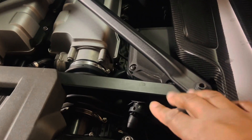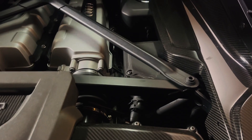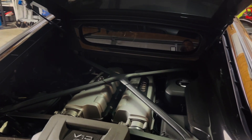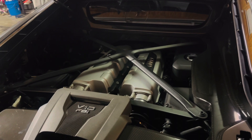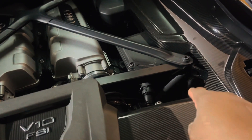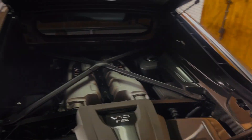Also on this side, as you can see right here, the fuse box. I had to remove this carbon fiber paneling piece, and that was a nightmare. So I had to get it off, open the fuse box up. Luckily, how it's powered and signaled is through a jumper — like a little jumper box for your fuses. So it plugs in: you take out the fuse, plug the fuse into the jumper box, plug it back into the fuse box, and ground it on the factory ground, which is underneath the paneling and underneath the fuse box. Once that paneling is off, it's exposed and easy to see.